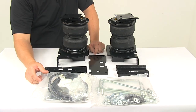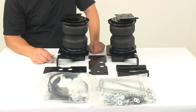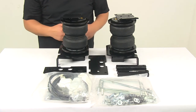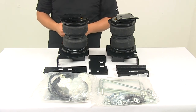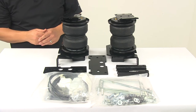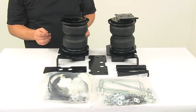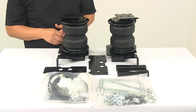This product is made in the USA and it's covered with a lifetime warranty. The load leveling capacity is up to 5,000 pounds, though the Load Lifter 5000 Ultimate Springs will not actually increase your vehicle's weight carrying capacity, so be careful not to exceed the manufacturer's recommended weight limit. Air pressure is adjustable — minimum is 5 psi, maximum is 100 psi.